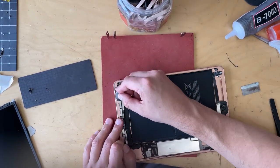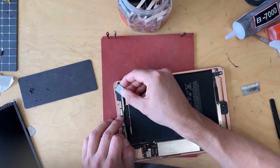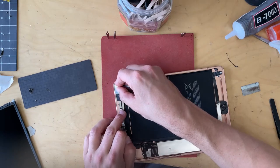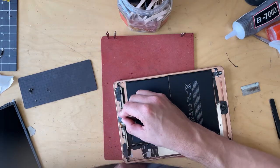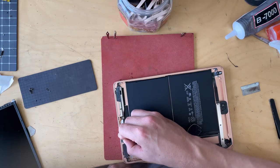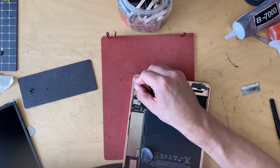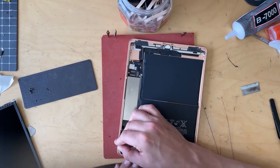Bracing with your palm down helps. When you come to something like a Wi-Fi flex, I just nick the adhesive — that's nothing that's going to damage the flex. But if you're too tilted you can nick and damage it, so you want to go at 45 degrees in that area too. You'll see I'm kind of pushing with my thumb and bending the blade — that allows me to get that little bit there. I come across here the same way: my thumb pushes down, I lift and push and bend to work around the whole perimeter.